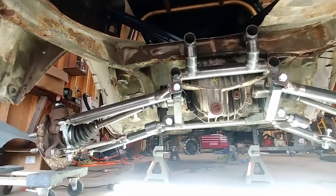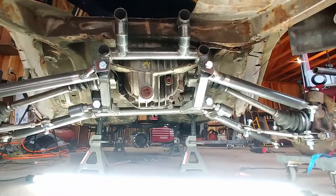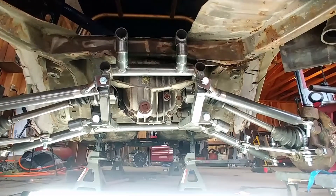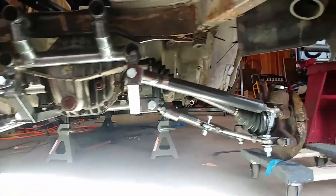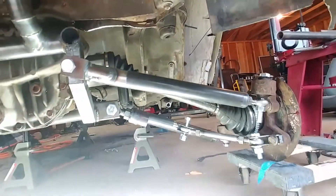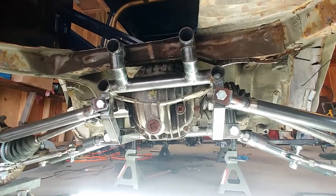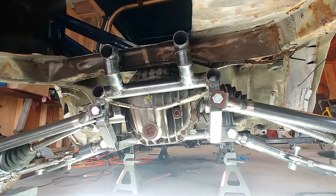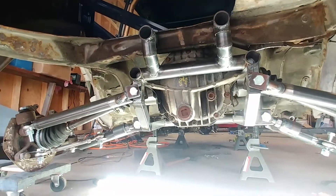As you can see, it actually fits decently well. This is going to be a track car for me, so it's really wide, which doesn't hurt me at all. Doing so, I was able to retain stock axles out of the Ford 8.8, which makes everything pretty cost-effective. The diff itself I got out of a junkyard for $175, and it actually has a factory 3.73 LSD.